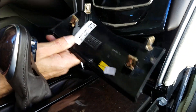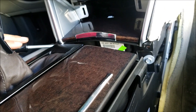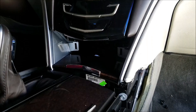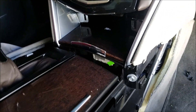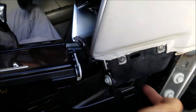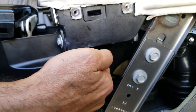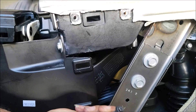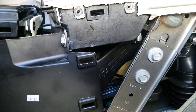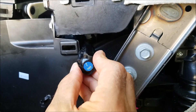This panel just has four clips. You can see the mounting screws — there are two underneath. Here is the tricky part: there is one screw underneath the ashtray which holds the ashtray to the docking for the AC unit. You need to put your size 7 screwdriver all the way in to open up that screw.